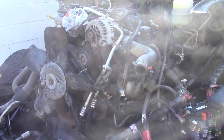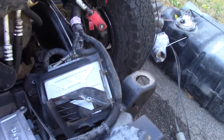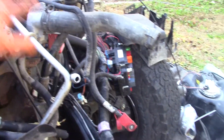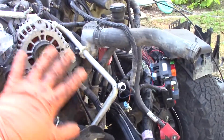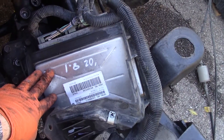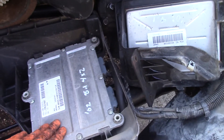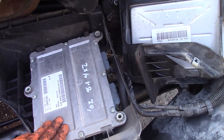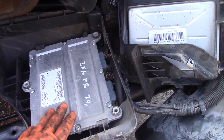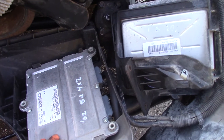So the engine is in. It's bolted up and bolted to the 4x4 Allison that's in the truck. I have the wiring harness mocked up. The engine harness is from the 8.1-liter truck. The ECU is from the 8.1-liter truck. The TCU here as well is from the 8.1-liter truck, which was two-wheel drive. I expect that this TCU will not actually work, but I'm hoping that this makes the whole VIN synchronization stuff a little simpler.